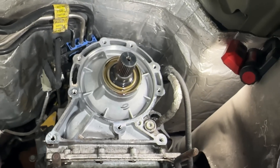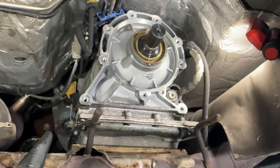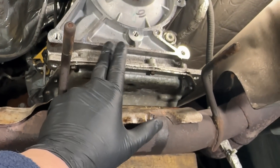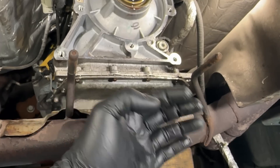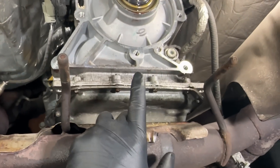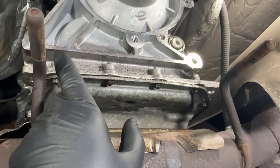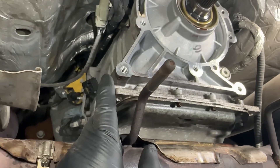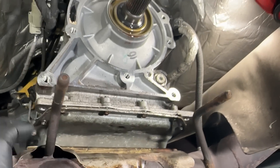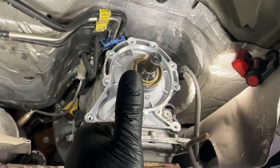I just wanted to make a video letting you guys know there is another source for this and you need to really look at it. Personally, if I didn't know the history of this truck, I would come in here, degrease everything really well — especially the mating surface between the transfer case and the trans — then go on a short drive. Not long enough to let fluid splash around inside and get whipped around by wind, which is how you cause misdiagnosis. A short enough drive where it will leak but not spread all over. Then come back and concentrate only on that seam to see if it has moisture or a drip starting — that's what's causing it to come down to the pan. Hope this helped you guys fix your Ford yourself. See you next time!